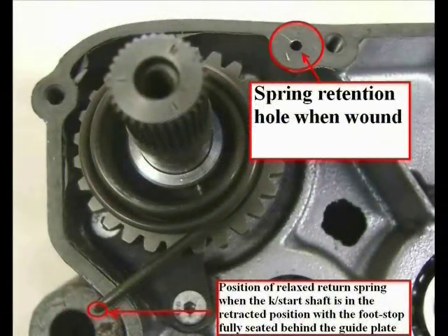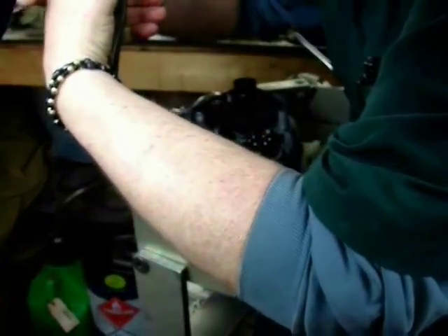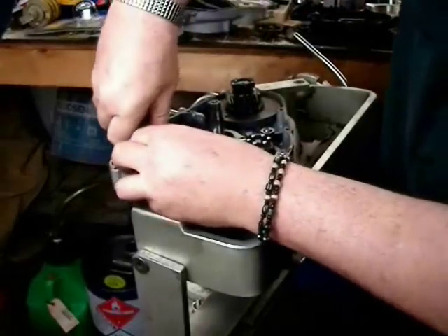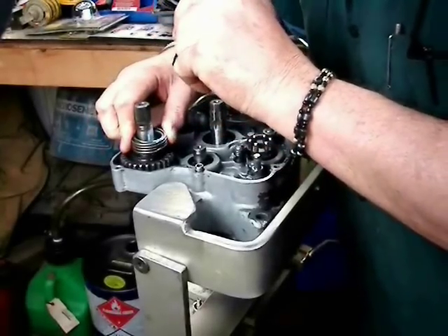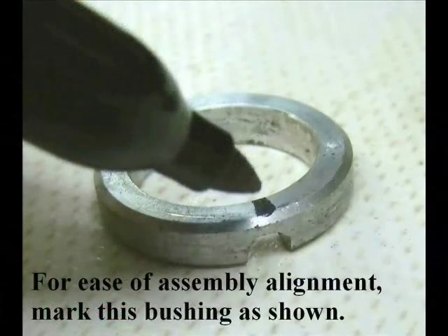In the relaxed position the spring is shown, then you wind it around to the two o'clock position and poke it into the hole shown. This is where you can get bit — that spring can fly around. Make sure the spring is seated. There is an aluminum bushing down inside that spring that slides over the shaft and has a notch that lays down over the spring where it goes into the shaft. All those parts must be seated or your clutch cover won't go back on correctly.